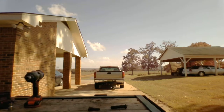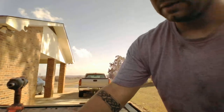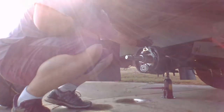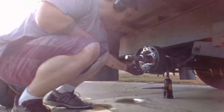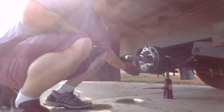Now we're going to take that down to the reassembly part of the job. You guys didn't know I had a lot of this pre-assembled for you. Right here these are your brake pads — these are obviously a point of wear. This magnet right here is going to be a major point of wear because it rubs against the inside of your drum to activate the brakes.